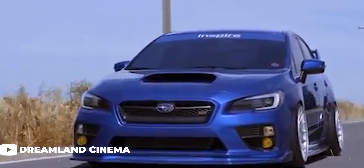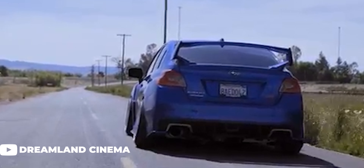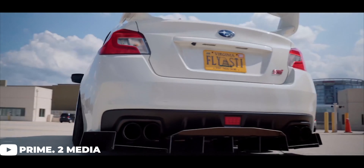18 by nine and a half plus 35 or plus 38 is what most people are running on the WRX STI — very typical of any modern Japanese car. However, there are plenty of examples out there that don't stick to the standard, and those are the setups we'll go over next. These are wheel and tire setups you could call a stance setup, aggressive setup, or fender-to-lip — whatever you want to call it.